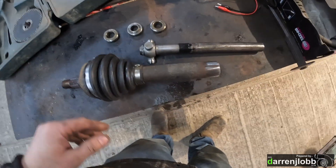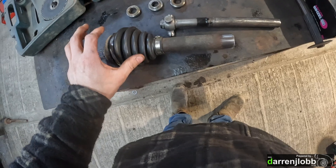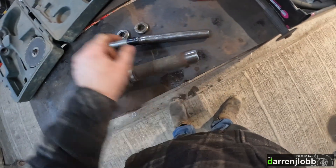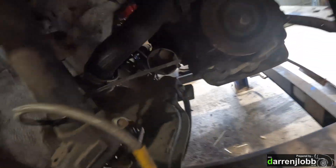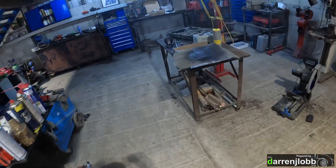I've cut these two shafts now and cleaned them up a bit. I've left the outer joint together for now because we don't need to touch that - it's the inner one we're worried about. I've just shined up these shafts slightly so I can tap them together, shined up the end of that one, cleaned all the grease off the end of that shaft, and also cleaned it out of this cup so we can see what we're doing without a chronic mess. Anyone who works with driveshafts knows what I'm talking about. So I'm going to put this shaft in and slide it in here now.